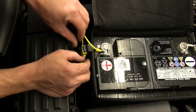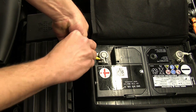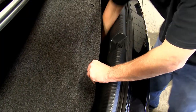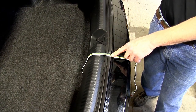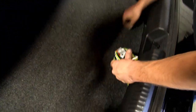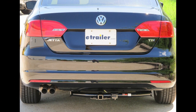With this application, we'll be using the blue 15 amp fuse. We'll go ahead and put our fuse holder lid on, and this will complete the install. Now we'll show you how to use your new four pole connection. Simply take the four pole connector and drape it out of the trunk over the rear threshold. Be careful to stay away from the latch, as closing it in the latch can harm the wire; however, the weather stripping is thick enough that it won't harm the wire. Once you're done using it with your hitch or accessory, simply roll it back up and store it underneath the spare tire cover. And that'll do it for our install of the Tow Ready T1 wiring harness, part number 119190KIT, on our 2012 Volkswagen Jetta.